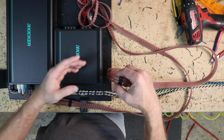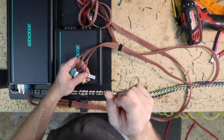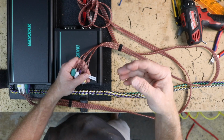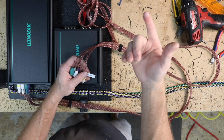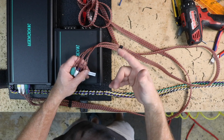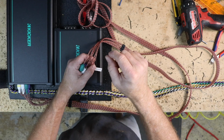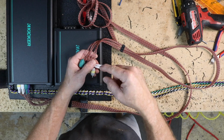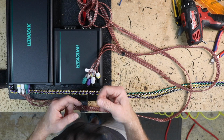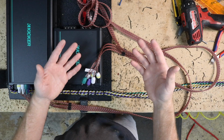One of the other unique features about the 4000s and a lot of other cables is they say they're directional. People don't know what that means. A lot of people get confused and say things like, I didn't know copper could be directional, or I didn't know a left twist over a right twist, or is my music going to play backwards? What it has to do with is there's a drain wire that is run through this RCA and it's connected at one end and not the other. So think of it as another shield on the RCA to keep noise away from it. That's it.